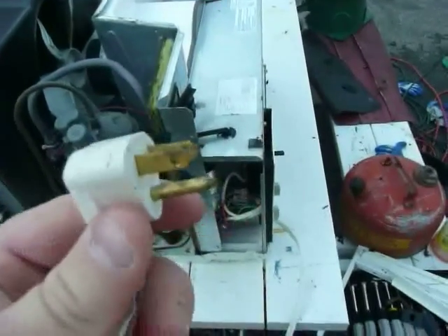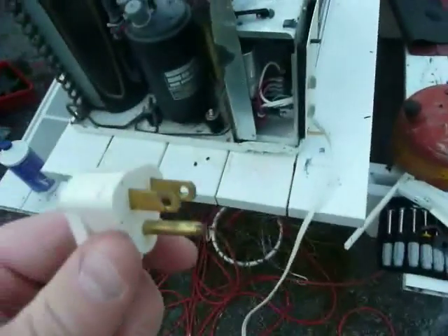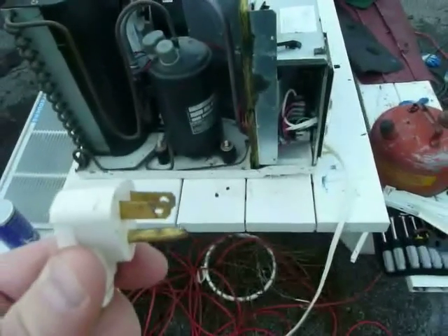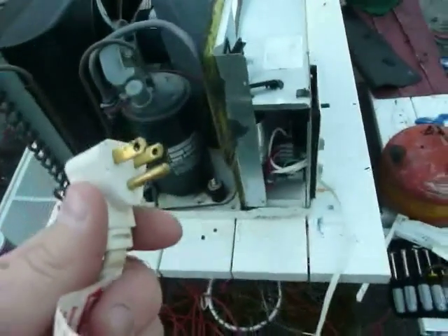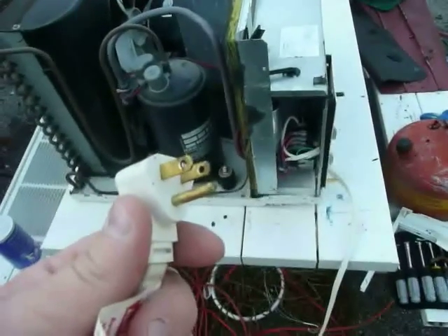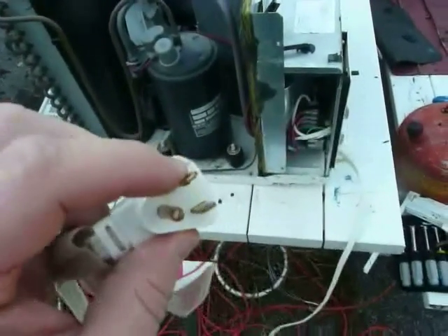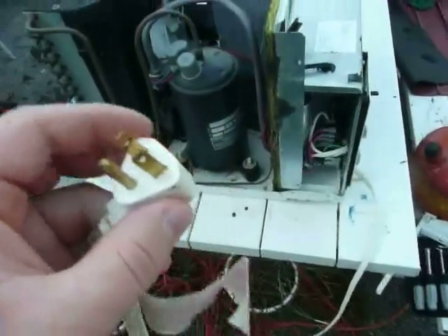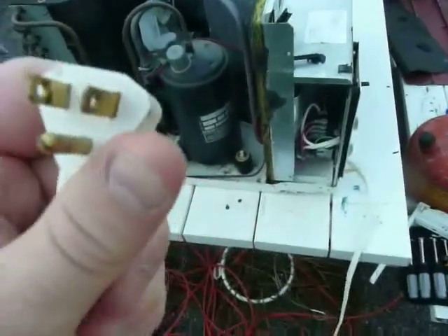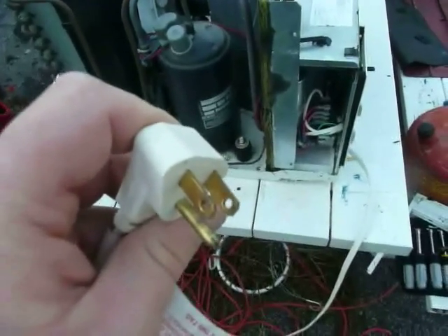Take a look at the plug on it. The terminals should look just like this — they should be shiny and either silver or copper colored. If they're dark, that means they're oxidized. Oxidation happens on high-energy electrical circuits and it robs you of power transfer from one circuit to another. It can also be the difference between an air conditioner that works well and one that works poorly and might even start a fire in your electrical outlet. If your plug's contacts are oxidized, you can usually clean them off with a file or a bit of sandpaper. If any of the prongs are loose or wiggly, or there are any burn marks or signs of distress, give serious thought to replacing the plug and consider replacing the outlet as well, because that will lead to a fire.